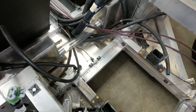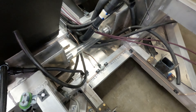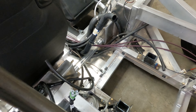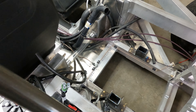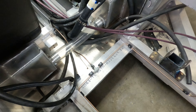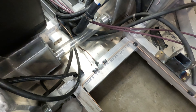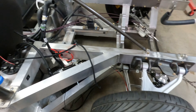I wanted to show you this — the fitting I'd been waiting on for the brake line finally came in today. I put it in the car and added brake fluid, and I think I've got the brakes working. I wanted to make sure there were no leaks here in the rear, because once I put the engine back in the car I cannot get to this fitting very easily to stop or fix a leak. The back hasn't leaked a drop — I think it is good. All the fittings back here seated well and were tight, and I haven't seen a single drop of fluid in the back.